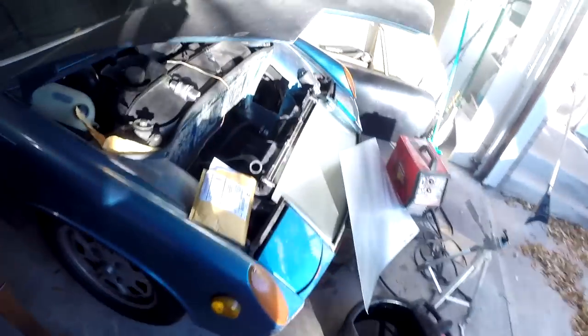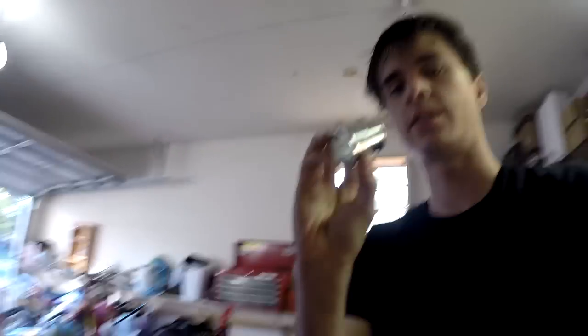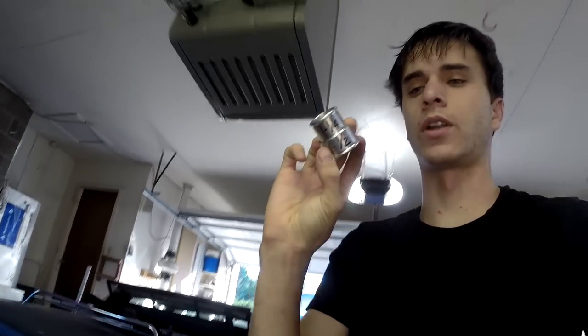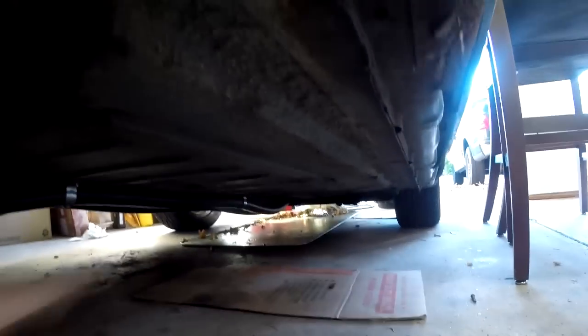I'm going to show you at the back how far I've gotten. I've got this radiator hose, which is an OEM Subaru piece, going down to there. Attached to that are going to be one-and-a-half to one-and-a-quarter aluminum adapter pieces that I just had milled up. Those are going to go to these hoses which I bought at Napa — yellow stripe radiator hose or heater hoses technically — running along the underside of the car. I need to put some more conduit hangers on there so it doesn't sag so much.